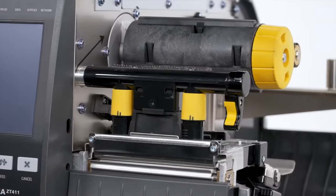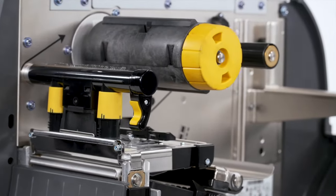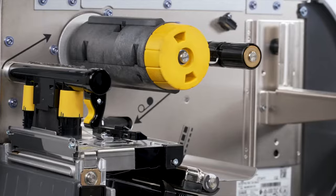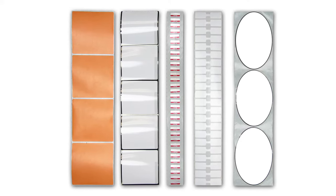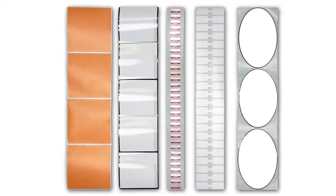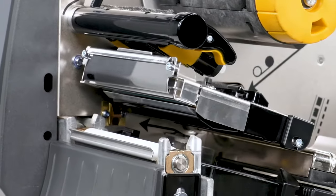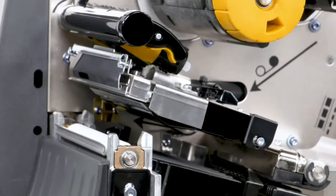If you're still having issues with your printer correctly identifying and printing on the media, then you may want to try a manual calibration. In order to place the image in the correct position on the media, we must first identify the features in the media you'd like the printer to detect. Second, you must make sure the sensors in your printer are set up to detect those features.